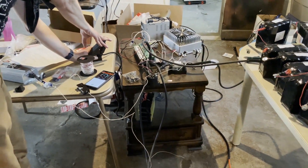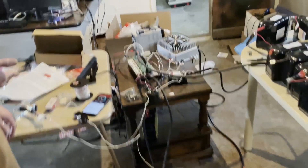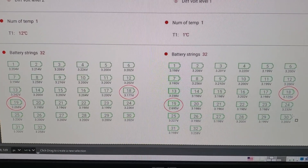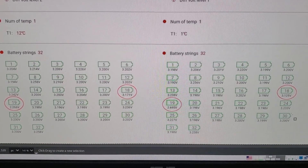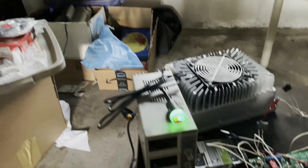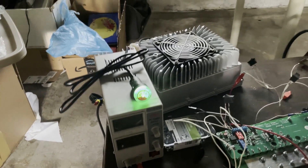It's been off for a while — it will drain if you run it. We're hitting negative 10 amps, and if it actually had load on it, we could make that number higher. We think the reason it works now and failed earlier is because before we got our charger, battery 18 was right at the edge of the voltage where a lithium iron phosphate battery will discharge properly. After charging the batteries and changing nothing else, the system works — suggesting the problem was the low charge, which has now been fixed.